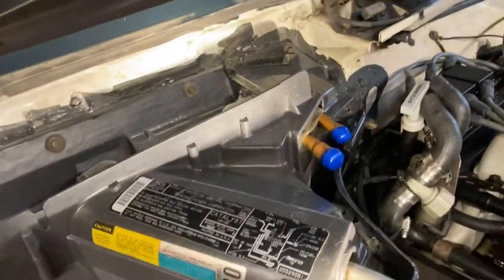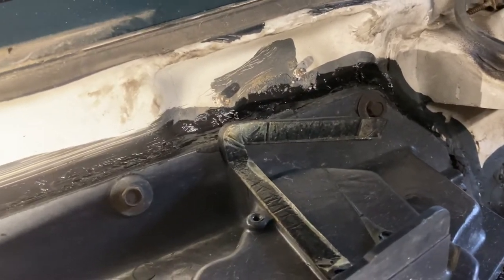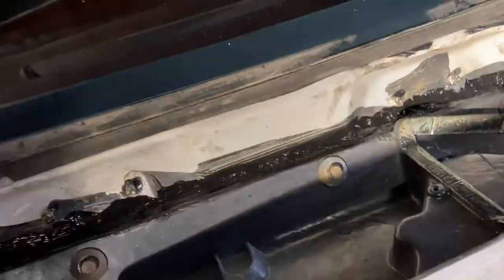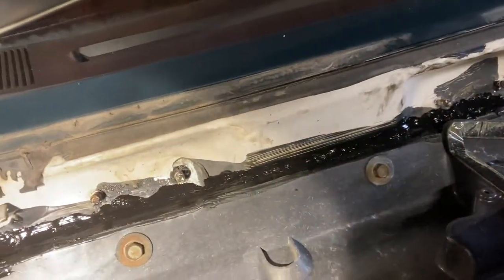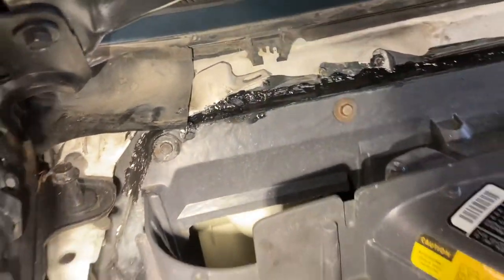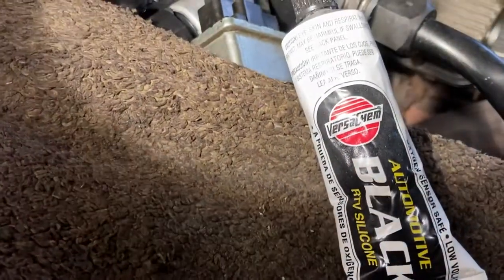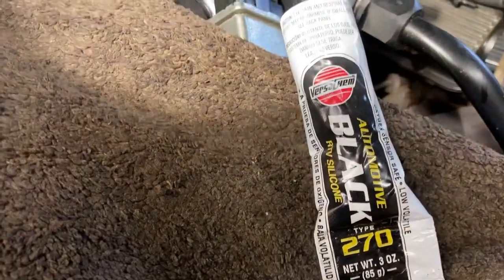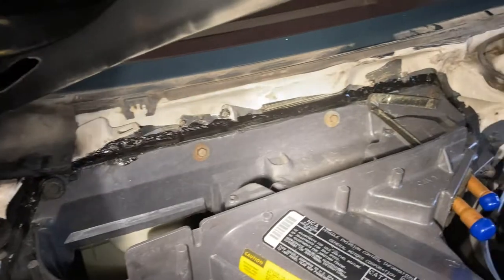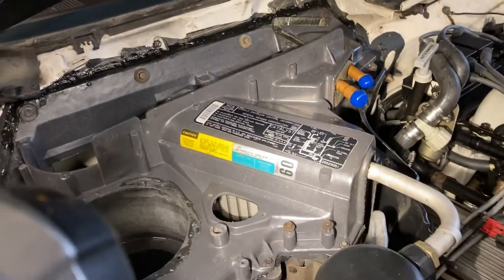Okay, let's keep going. There's our heater core. Okay, and then we're all cinched down the way we want to be. And I'm going to tuck that seal up there. Yeah, and I put a little RTV on the top of that shelf. You just don't need to go crazy here. And I'm a pretty frugal guy, you know, but yeah, VersaSeal. Couple bucks, RTV. It's a good little insurance marker. And, you know, get it sealed back up. So that's done. Let's keep going.